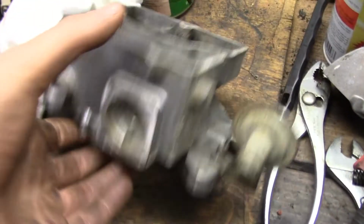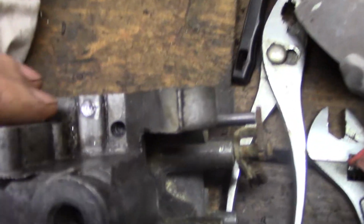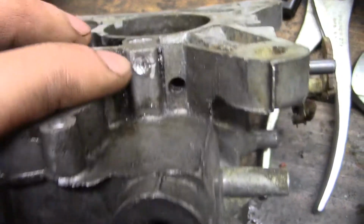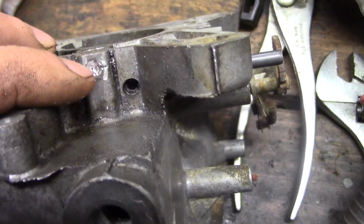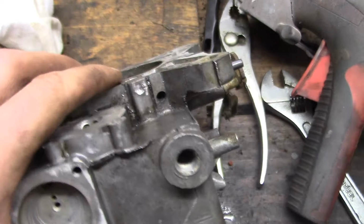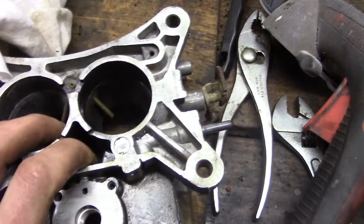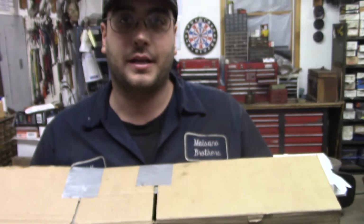Yeah, so we didn't really do so well with this situation here. It just keeps getting worse. Yeah, snapped the thing off, of course, and I had a nice cobalt drill bit that will drill that hardened stuff out, but it was too big, and I started wandering off center a little bit. So, short of getting another drill bit, a smaller one, to drill through and maybe salvage it. This is a junk Ford carburetor. It's a real abomination. But I want to make it work, so I'm going to liberate a drill bit from work,